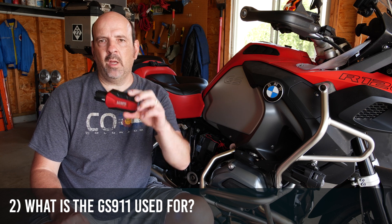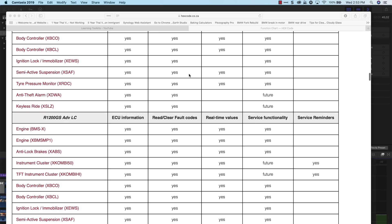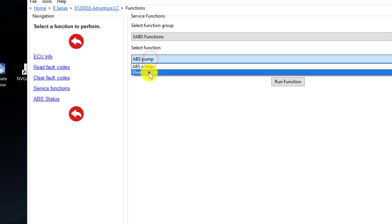The second question is: what is the GS911 unit and what does it do? The GS911 connects to the CAN bus on your system and gives you access to a variety of functions. I'll put a link to their website in the description below. A couple of examples: setting the date and time, resetting the service reminder, or activating the ABS pump — which is what I want to do here to bleed the brake. The only other way to activate the ABS pump is out on the street pressing the brakes very hard to lock them up, which obviously isn't a situation you can use for bleeding. So this gives you the ability to access that ABS pump during the bleeding process.